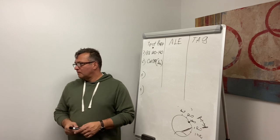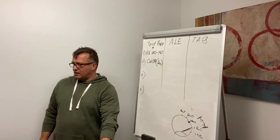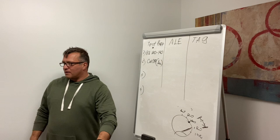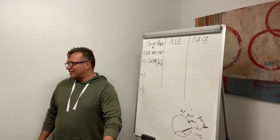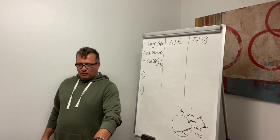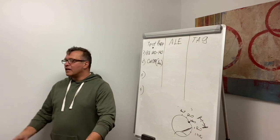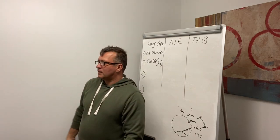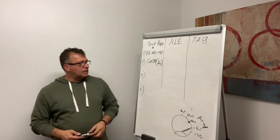So in order to turn on to the battery, first we have to go off and then go to the left? Yeah. Don't put it in battery. One click on the key, one click left. Wait a second until the engine stops completely. Because if you do it right away, one click left, then right away one click right, it will just lock the engine and it will keep running. So one click left, wait until it stops, like 2 seconds, and then click right. All these lights will show up. You wait, some of them go off, and it's ready.